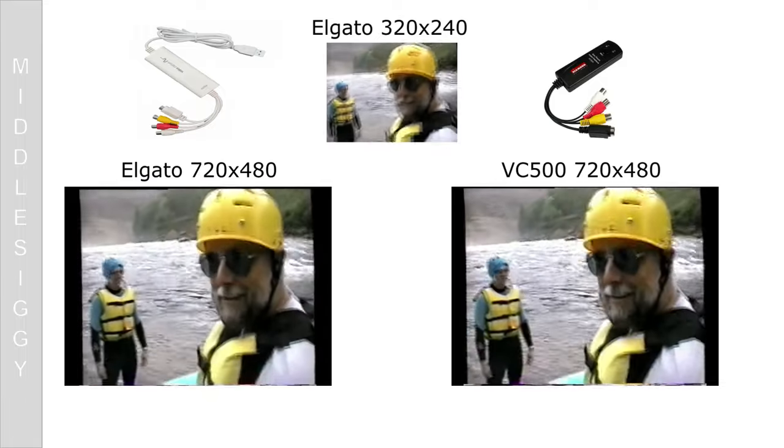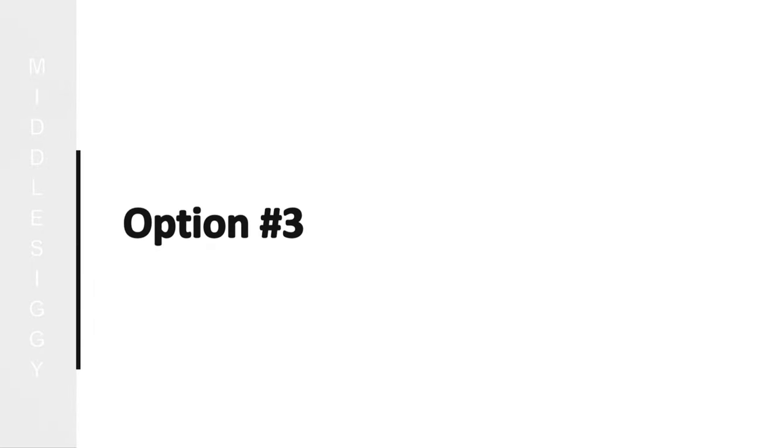The Elgato software also supports multiple formats and aspect ratios should you want them. My final method for this video is using an upscaler and a high-definition capture card, which will convert the analog signal into a digital one and at the same time take it from 320x240 to a high-resolution 1920x1080. We're going to take the upscaled 1080 HD image and capture it on an Elgato HD60 Pro capture card inside my PC. There are a few other Elgato capture devices, and I'll leave a link below should they fit your situation better, as you might have a laptop and can't put an add-on card into it.